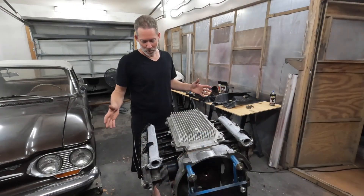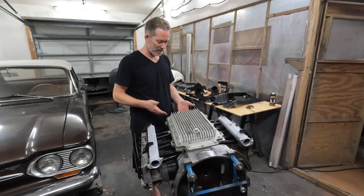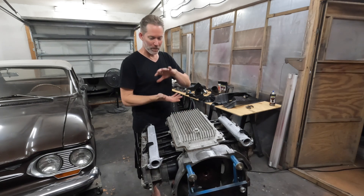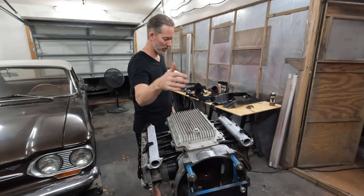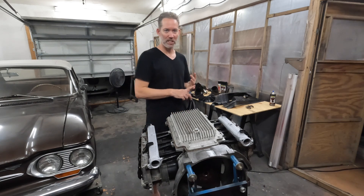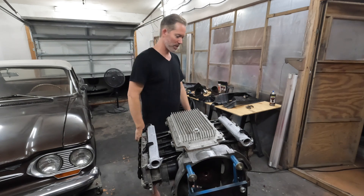We've made a lot of progress in this episode. We sealed everything we could. But right now I'm just waiting for parts. I don't have the washer that's missing for the rear main seal. Until I get that, I can't seal it, flip this over, get it back on the table so I can fix the front main seal. And finally get back to the transmission and the diff, get that sealed up and reconnected and finally get back in the car. But we have made some progress - we painted some stuff, it's looking a little bit better.